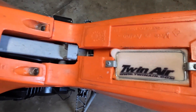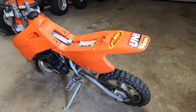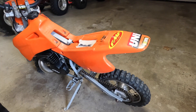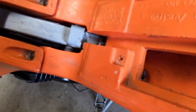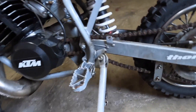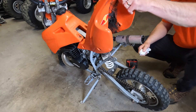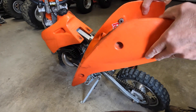We've got a brand new air filter. Not really sure how that connects. Let me grab a screw gun. As we can see it's just a hole going to atmosphere, and you're never going to get this to run right if you don't have proper back pressure. Let's take these plastics off — it's got all kinds of different mismatching hardware on here.